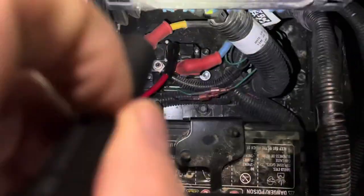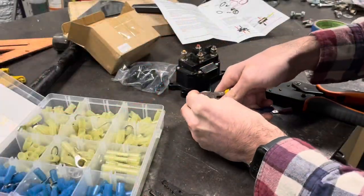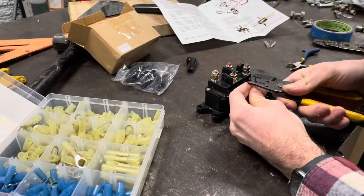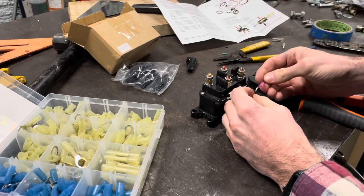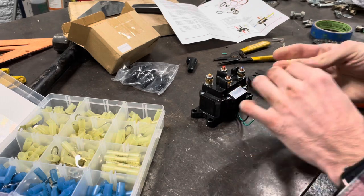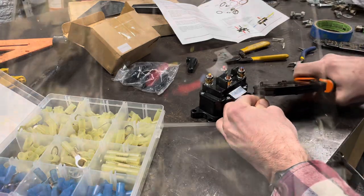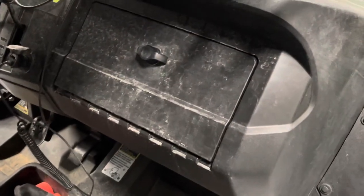The other thing I should mention is that this solenoid came with bullet connectors, but it's for a spade style. So I had to switch those — basically cut off the ones that came with the solenoid, reinstall and shrink the spade connectors on the solenoid leads, and then hook those up. Once that's done, your remote can then plug in here in the back, and it's good to go. Once the key's on and you flip the remote forward or backward, that will power your winch. I estimate that job probably takes around two hours to complete if you've got all your tools lined up.